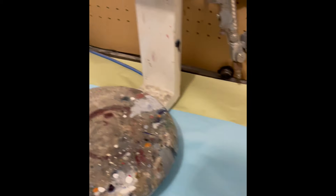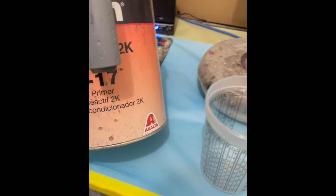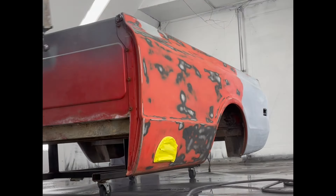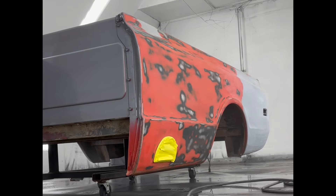For the bare metal parts — sorry for the noise in the background, it's a mixing machine curing — I'm going to use Nason Select Prime to go on the inside of that bed before I put sealer down. The part number is 491-17, it's a one-to-one. Basically you want to be able to read a newspaper through it when you put it down. It doesn't need a whole bunch, just something to catch a mechanical advantage.